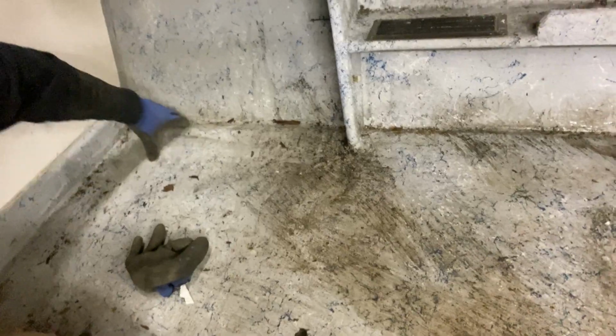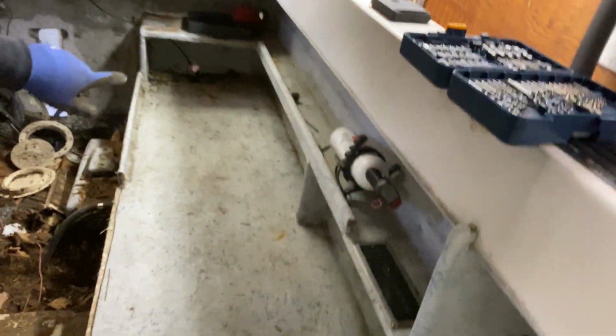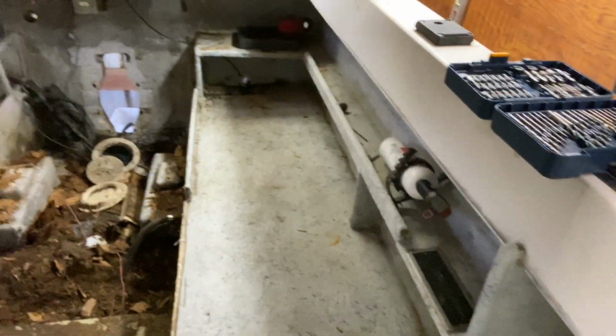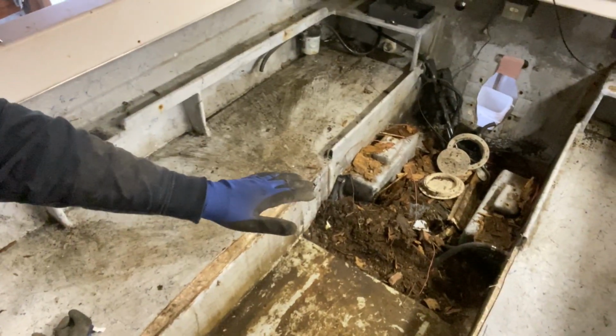So I'm going to run it out about 4 inches all the way down on both sides here, and that would give me enough to tie in the fiberglass when I lay down new boards, because this is all going to be a complete flat deck.